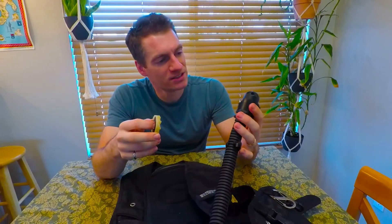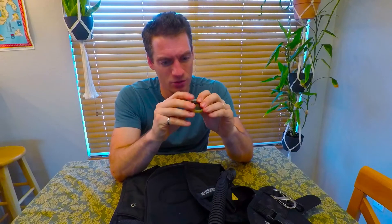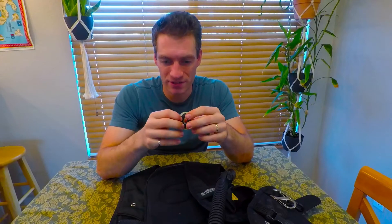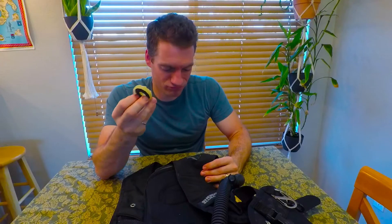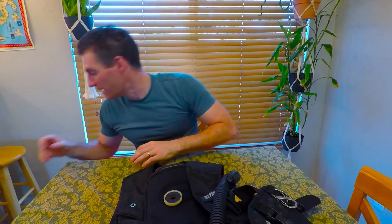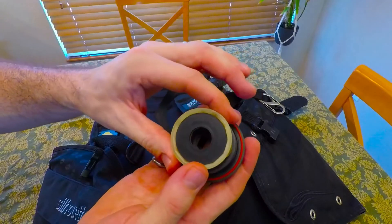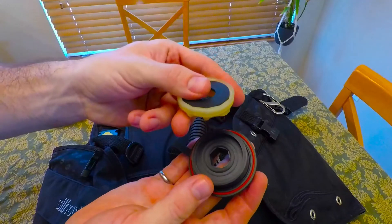This was really unsatisfying for me, because the rest of this filler hose is clearly high-quality UV-stabilized plastic. But the part it threads into is clearly not — this is virgin material, I'm not sure if it's LDPE or polypropylene, but you can tell by the color: it's basically translucent and whitish, meaning it has no additives at all to improve its longevity. So basically, they've designed this so that this part is going to fail before anything else, and they refuse to sell you a replacement.